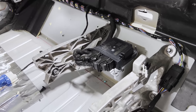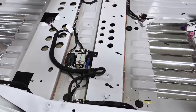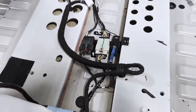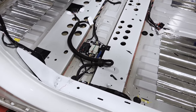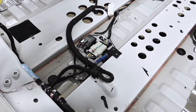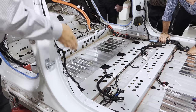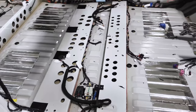One interesting thing on the floor: there are two in-lines going across the car, and one of those in-lines looks like it has about six circuits but uses about a 12-way connector. You could have put a six-way in and handled the cross-car run — this vehicle is loaded, and if you have more features to add you go to the bigger connector, but it almost looks a little old-school, like somebody was protecting their space claim and just put the bigger connector in. There's a gram or two of weight that could be saved there.